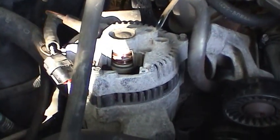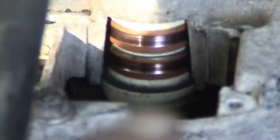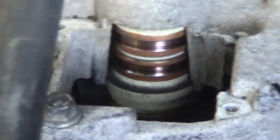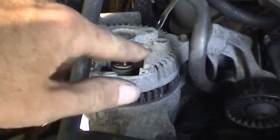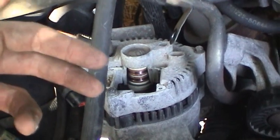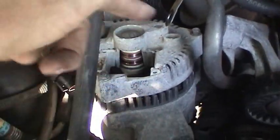The regulator is out, and you can see the two slip rings right there. The one on the bottom here looks a little grooved, which is actually kind of normal — they should be perfectly flat and smooth, but they're good for continued use. Those are the two slip rings; they are basically the contacts for the rotor. The rotor is just a big coil of wire — it's an electromagnet — and those two slip rings carry current from the battery to basically excite, or apply current to, the claw pole rotor and generate your voltage.